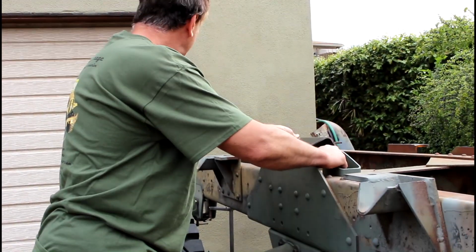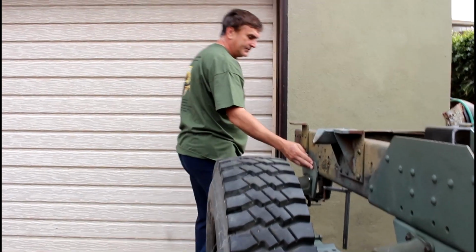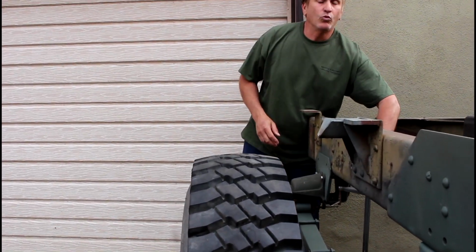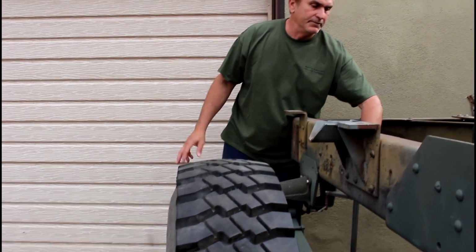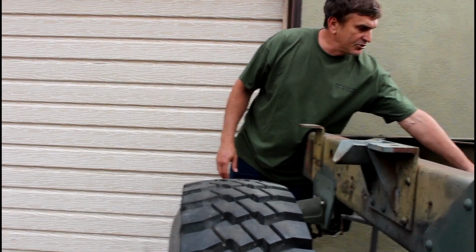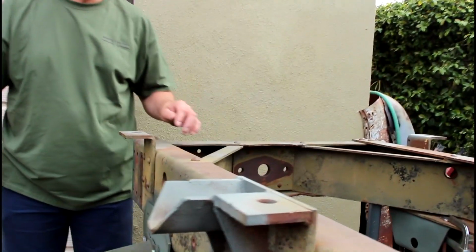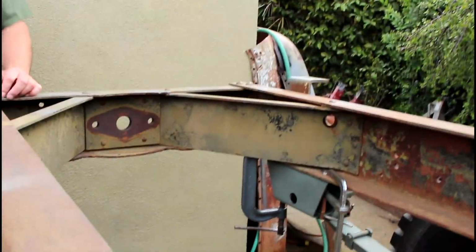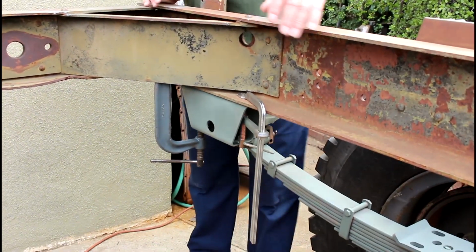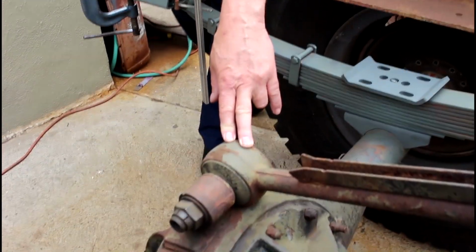Okay, for the back side, I added the plate to bring it up to give it support on the side. And I'm going to be running like a 1x3. I haven't sourced it yet, but pretty much a 1x3 rectangular tubing in between the two above the spring pin hole. And I wanted to keep the dog bone on the top to help locate the pinion.